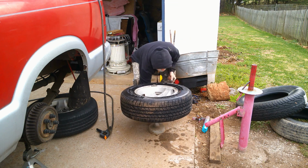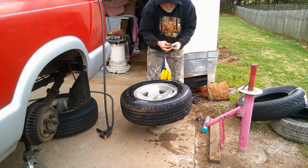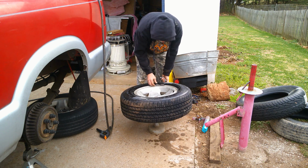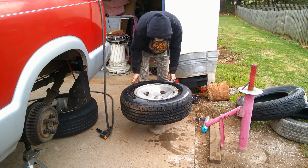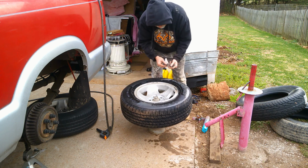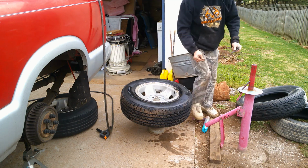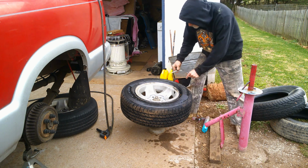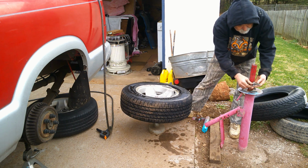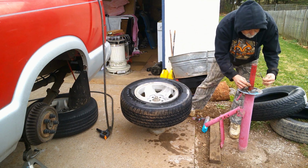what you need to do is clean the back off, and you can get a sticky weight, which I have too. Now this is going to need quite a bit, but maybe not. Might only need these two at the right place. And maybe not all of them. You might just need two small ones. So you want to look at the weights you're going to put on. I know that's a steel one. I got one big one. Let's see if a big one works. That's probably too much. A lot of people will put that on and then put a weight over there. Don't do that, guys. Please don't do that.